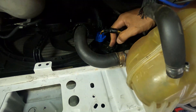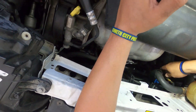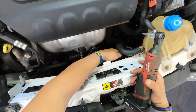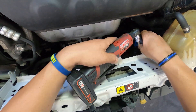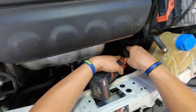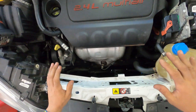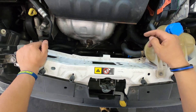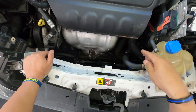Let's put this back where it's supposed to go. We need to find a bolt — the bolt goes in there — because this one is definitely not bolting in there. Let me see if we find a bolt around the shop. All right, I found a bolt. We're going to tie the resistor fan in there and make sure it's in place. I moved the connection that was going to the resistor directly to the fan, and the one that was connected directly to the fan, I plugged that one to the resistor. So everything is good.